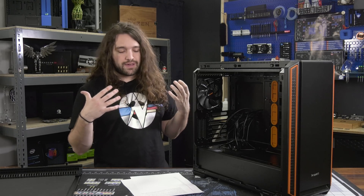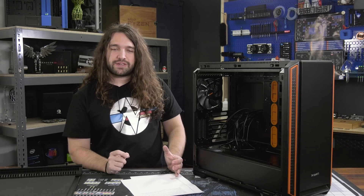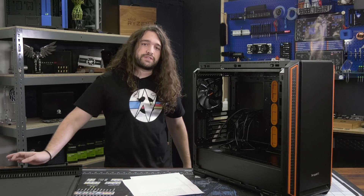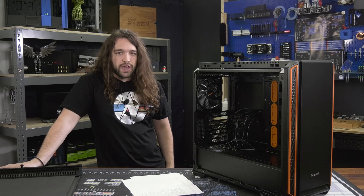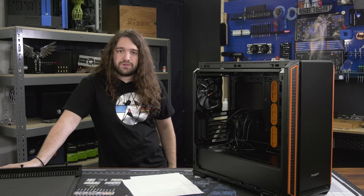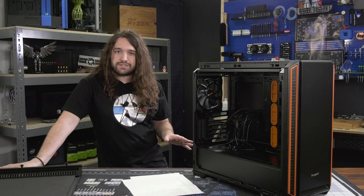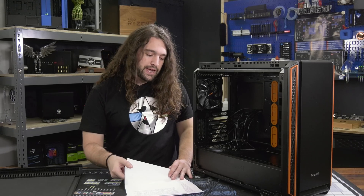The next question is: if you just buy a case with a more open front panel and spin down the fan RPM to equivalent noise, matching the dBA output, at what point are you then getting superior cooling for the same noise level? That's something we're investigating for several pieces, because it's an interesting question. $130 — it's fine. Build quality is good. Thermal performance on the GPU is acceptable. Thermal performance on the CPU is not good. But if you buy an extra fan for the top or front panel, it will be fine. Stock, it does not fare well for sustained CPU render loads or sustained workloads.